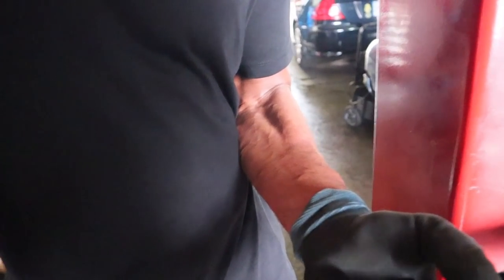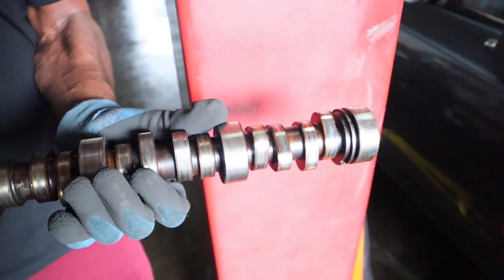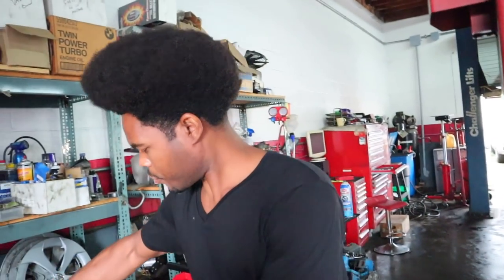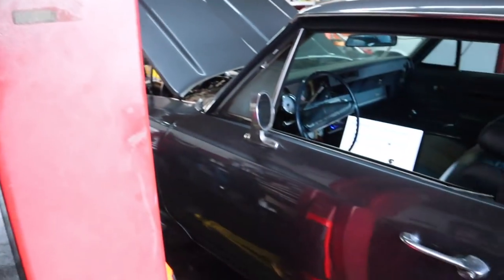Let me check out the cam. Yeah. Oh, like right there, yeah. Talk about like the little burn spots. Mm-hmm. It's not terrible though. Got some miles on the thing though, for sure. Right. So you put a sloppy stage two Elgin cam right here. All right, and you said also you did springs. Yep, this pack, 1218 springs. All right, cool. Good, man.